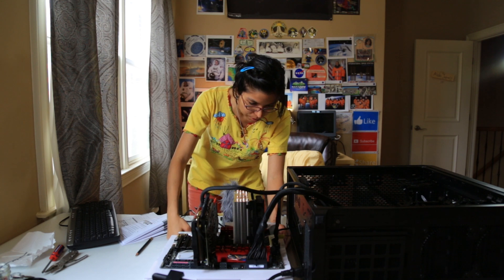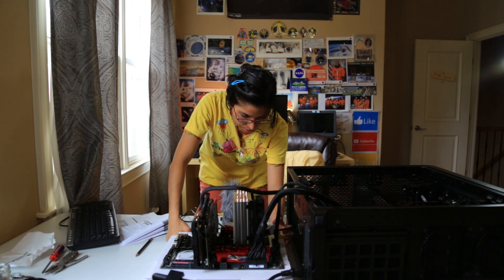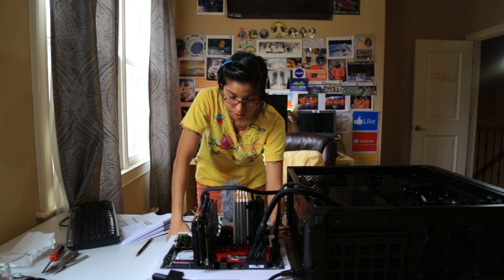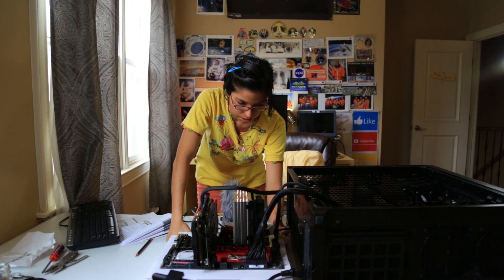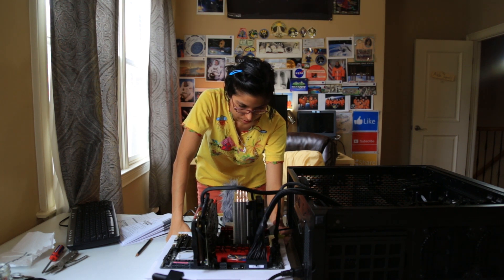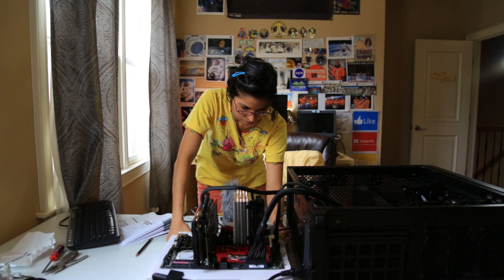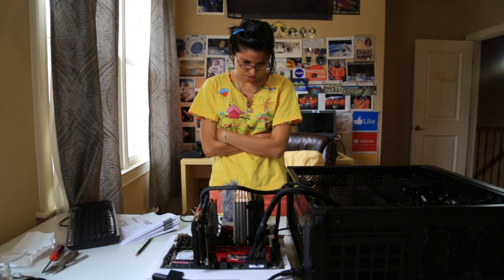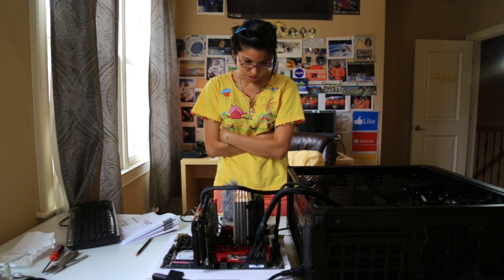Go to the BIOS button and press and hold it for three seconds. It should flash three times, then you can let go. It should continue flashing, and you shouldn't touch it until it's done updating. One, two, three — now let go. See if it continues flashing. If it continues and later turns off by itself, it's good.